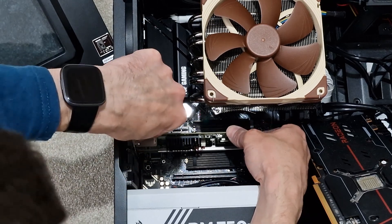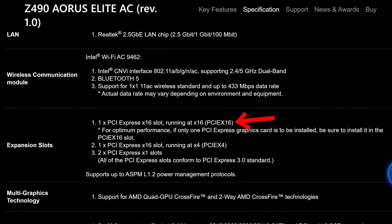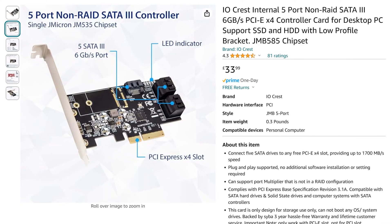On the other hand, putting a smaller PCI Express card into a larger slot should be fine — but there's one exception worth knowing about. Some motherboards have multiple X16 slots where not all pins are connected. So you might see a motherboard with two X16 slots, but if you check the detailed specs, only one runs at X16 — the other runs at X4. The extra X16 slot allows you to physically fit all sizes of PCI Express cards, but its max bandwidth is limited down to X4 speeds. This might still be fine for some cards like SATA expansion cards, since SATA drives don't typically exhaust X4 bandwidth, but it's worth bearing in mind.